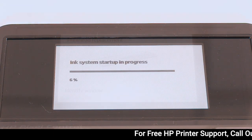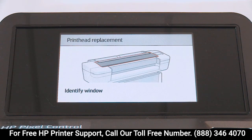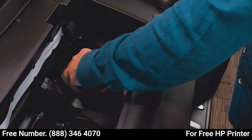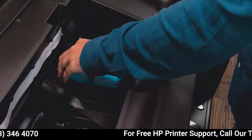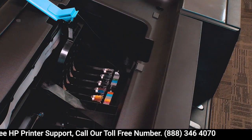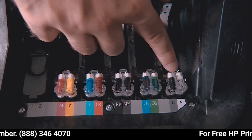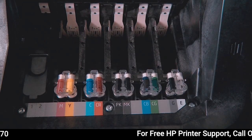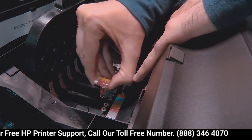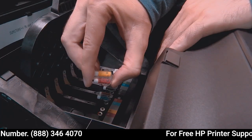This process takes around 10 minutes. When the ink system is ready, the front panel will prompt you to open the window and print head cover. Open the window, remove the label from the print head carriage, and pull the blue print head cover handle up and towards you to release the latch. Push the handle back to raise the lid and access the setup print heads. Look at each setup print head to verify that it has ink inside — the setup print head's only purpose is to prevent ink loss during ink cartridge installation. Remove and discard all the setup print heads — you may need to use force. The setup print heads contain ink which could leak out; avoid touching pins, leads, or circuits.